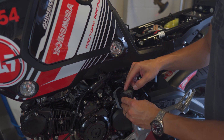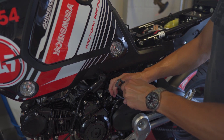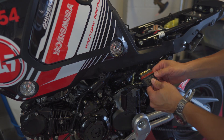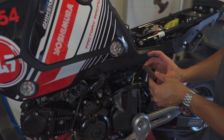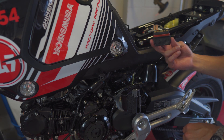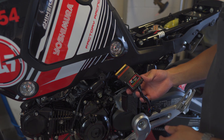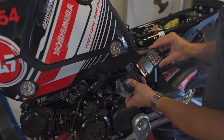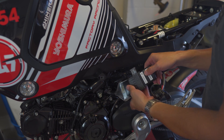With that out, I take the rubber boot off. There's a gray clip that you slide out and then the ECU slots out. You can tell this ECU looks very different from the previous one that came on the Grom - it has this little rubber seal and looks entirely different. We'll be replacing it with the RC Mini 5, which also looks very different from the previous model. It only goes in one way.